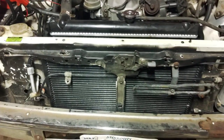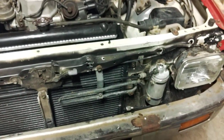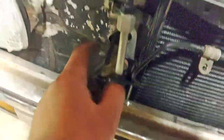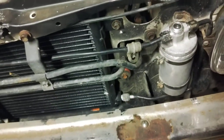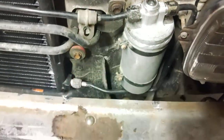Under the hood, we'll start at the front. Strip the grill off and here's where the condenser goes, and you'll see the dryer. There's a bolt here, here, there, and there. The line comes in here — there's a compressor manifold down there. The liquid line comes across here, through the back, up and into the firewall to the evaporator assembly. There's supposed to be a tab that bolts here and here. This is the original condenser, but it's been swapped out for a newer type. The dryer mounts here, with another on the back and one down behind it.